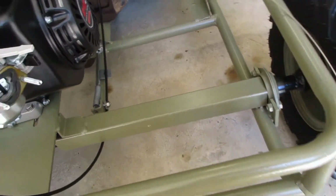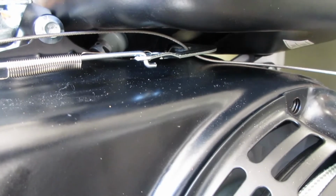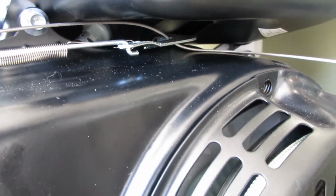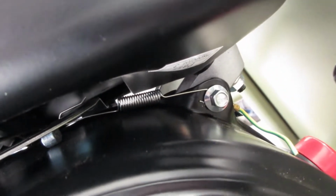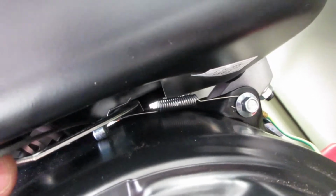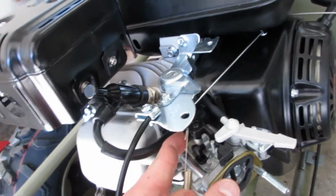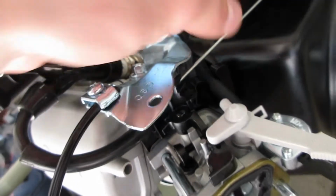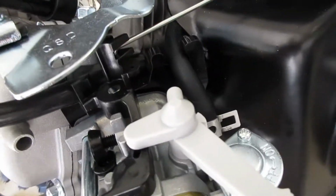But I'm going to pull the cable the rest of the way through, and then I think before I do anything else, I'm gonna show you guys how to hook up the spring to make sure the throttle's gonna spring back the right direction. So let me pull this cable the rest of the way through, and then we'll set that spring up on there. Alright guys, spring is attached. You can see I just went right to the side cover bolt there. You can just bend that around, trim it, to make it work. But you can see it has a little space in between the coils, and it doesn't stretch too far. And now our throttle springs back to 0, which is real good. It's super springy. It's really nice. It should work well. Even if the cable's a little gunked up, it should still spring back.